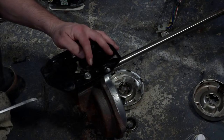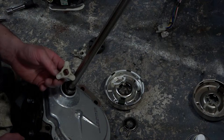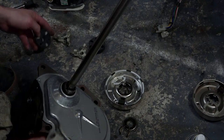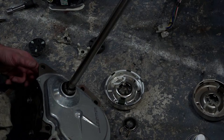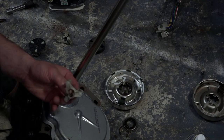Coupling out while I'm here. So guys, I got this weird conspiracy theory about the plastic and then the metal insert couplings. Every machine is designed to have an intentional weak link. It's not that they put it there to fail, but so that if there's ever an extreme situation, something will give, in lieu of burning wires, burning the motor up, burning the timer up. And that's what this coupling was. This was the natural break point to disconnect the motor from the drive system.